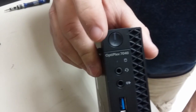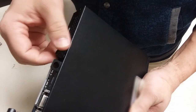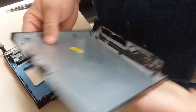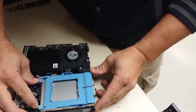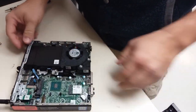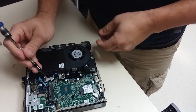So as you can see, this is an Optiplex 7040 — it's a micro form factor. Right there's the screw that you unscrew. You can either use your fingers or it'll take a flat or Phillips head screwdriver to take off that front face and the top cover. Next you'll need to remove the hard drive here — that just slips out. Then I'm going to be removing the heat sink and fan assembly.